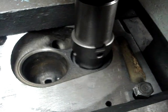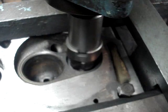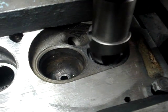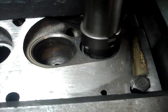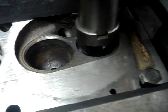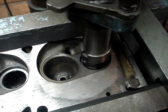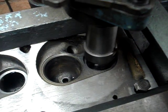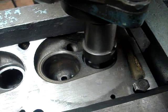Slow speed — we're just going to cut the center of that guide hole out so that we don't have any kind of a mismatch or any disruption in airflow. On a stock set of cylinder heads, the average everyday machine shop might just let that go, but the high-performance machinist in me just can't let it go. I have to cut these — even though this is a basically stock engine, I'm still going to cut the center of that out so there's no mismatches.